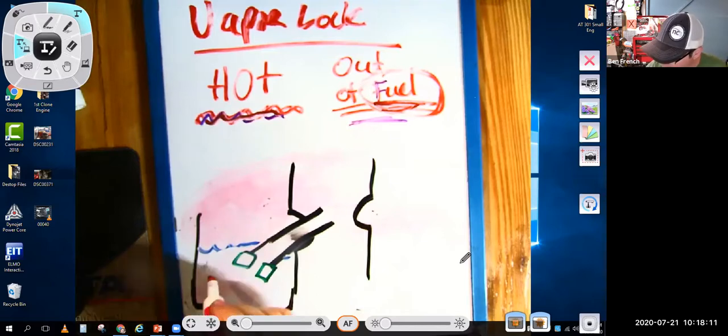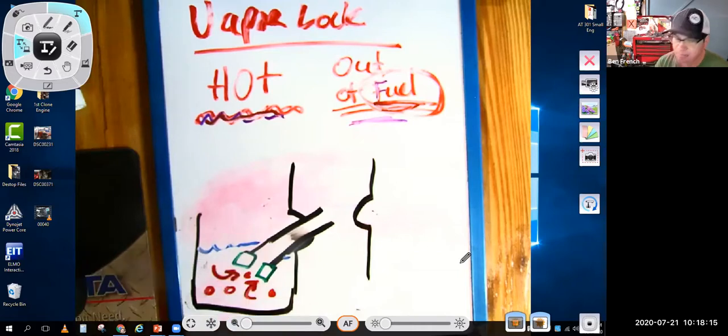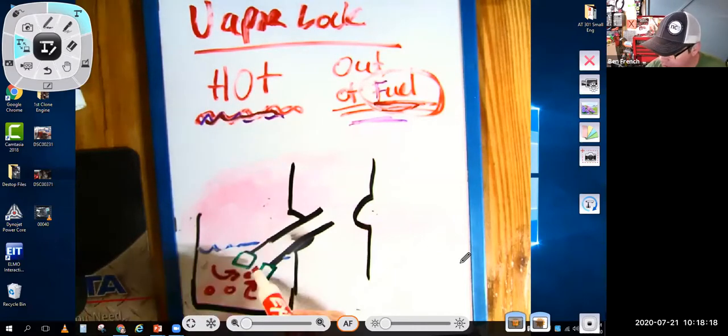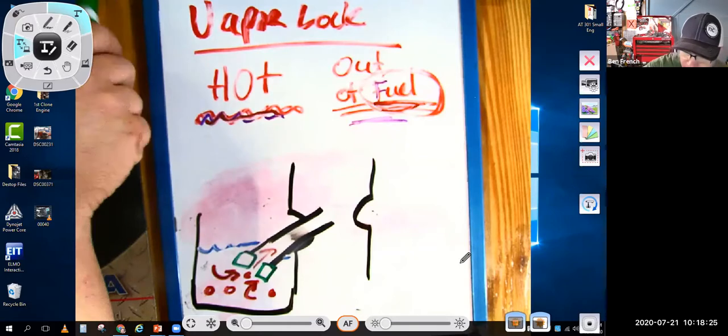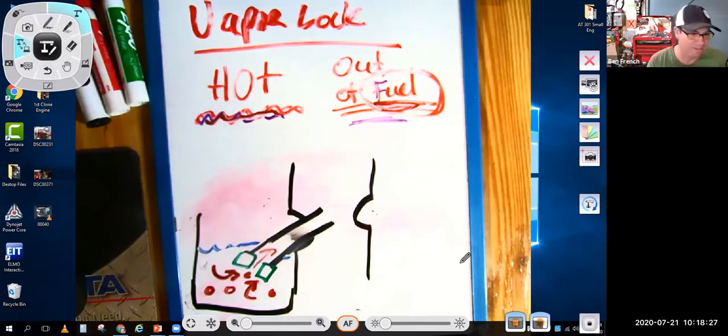Two, if there were little bubbles in here, I now have a bigger passage and those bubbles could get through and it wouldn't vapor lock the engine. So that's what they were talking about there. Just my opinion, I feel like it was probably 50-50 between keeping people from messing with stuff and this vapor lock issue, but that's what they mean there. So, anyways,